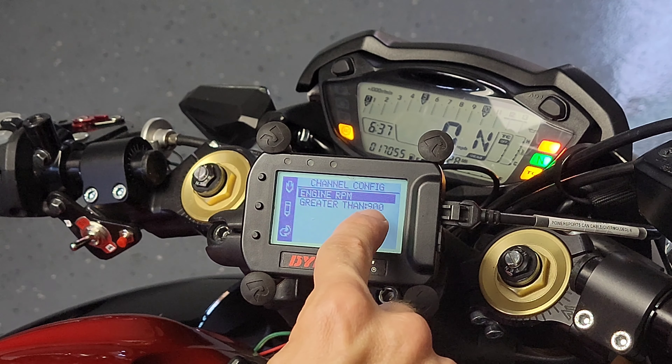I'm waiting on a small plastic housing I purchased to make this a more permanent installation for the LED. I plan to mount it up top, maybe with velcro, or place the LED somewhere on the bike that makes sense — keeping it black and in a small housing so it looks clean. For now it's temporary. I also changed the RPM parameter to 2,000 for this demonstration, so the light won't come on at idle but will trigger when I give it throttle.